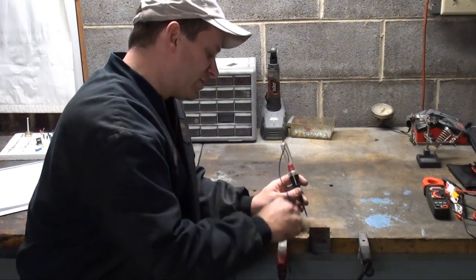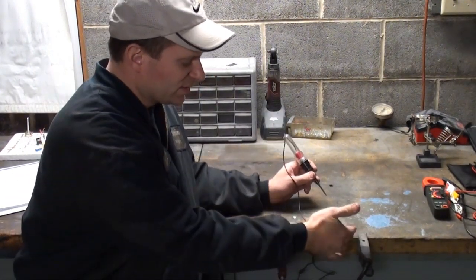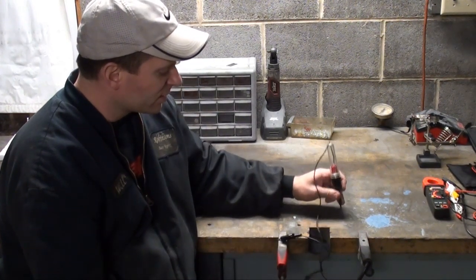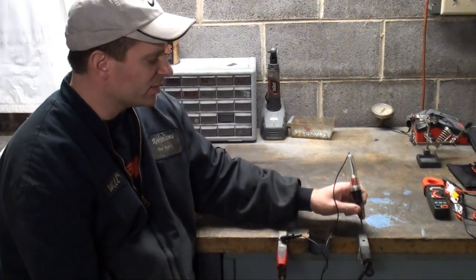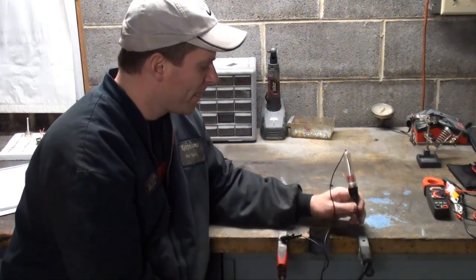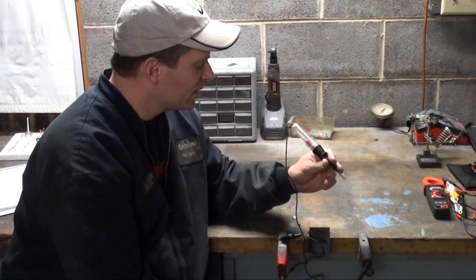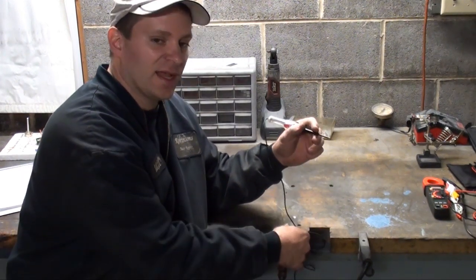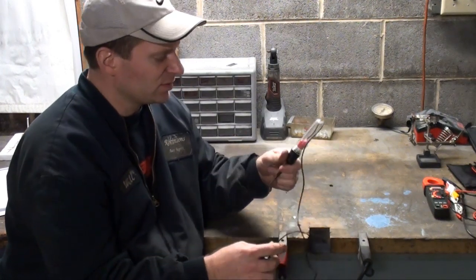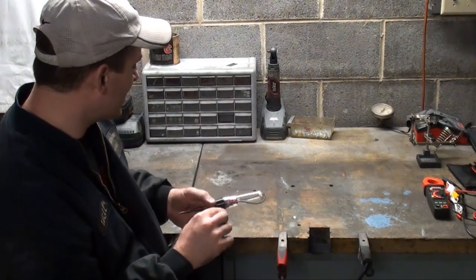If I wanted to find good ground, I'm probing around. I know that even though this is connected to this wood, it's not a good conductor. But then I come to the ground, I find a good ground, and the circuit's complete. A test light is a real simple circuit, but it's very handy to have and very useful — you'll turn to this a lot.